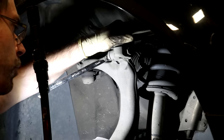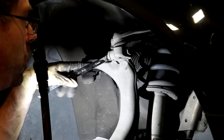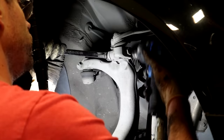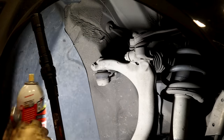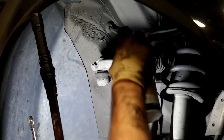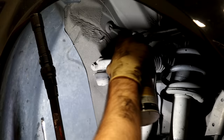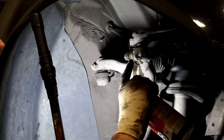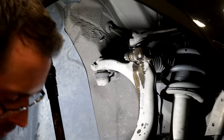Because we cannot get enough movement and don't have enough room on the passenger side, we're gonna be taking the upper control arms loose from the steering knuckle right here. We're gonna start with this pinch bolt — this is a 16 millimeter. This side's coming loose, but we're gonna need some penetrating oil. Again, we're in the south where this is usually not as big of a deal. But if you're in a place where there's a lot of corrosion, these are brutal. You're gonna wanna start working with penetrating oil on this before you even get started, because it's probably gonna need to sit for a while. Torches are very common in the north, where you have to torch this thing and completely melt the bolt down.